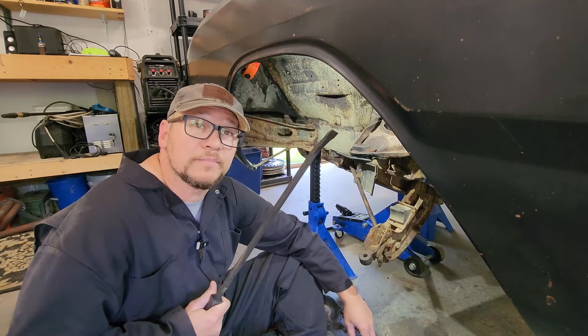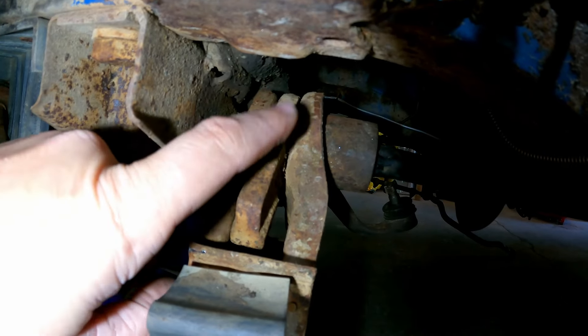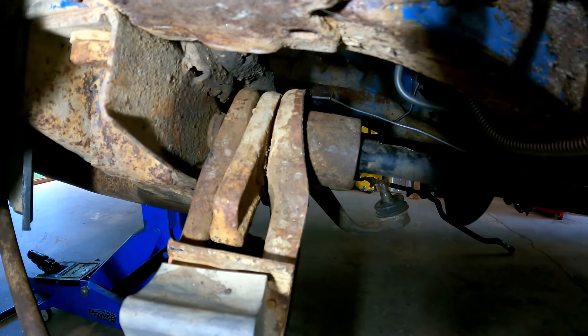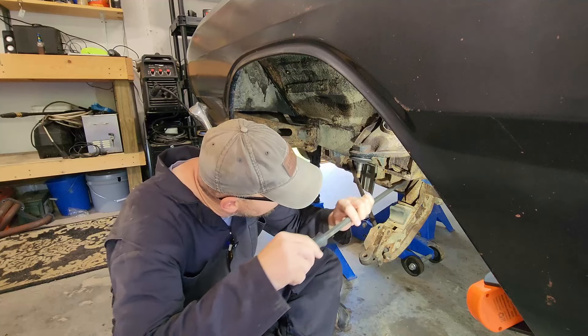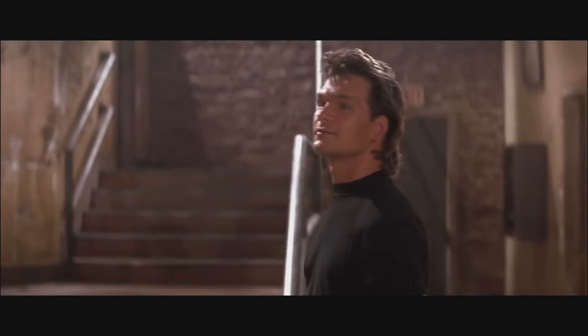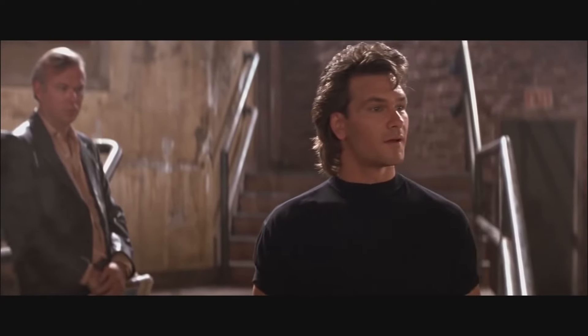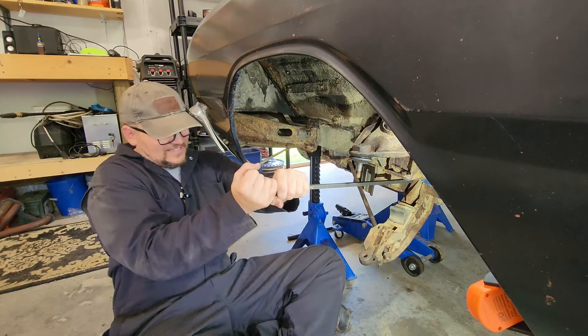Those are the things I've tried so far. I've done a little bit of research and got a couple more things to try before we get to the ultimate solution, which is a cut-off wheel and new torsion bars. Next up is the good old pry bar. I'm going to run it right up here between the k-member and the lower control arm and just wrench on it a little bit to see if we can get this whole thing moving. Wedge it in there and be nice... until it's time to not be nice.